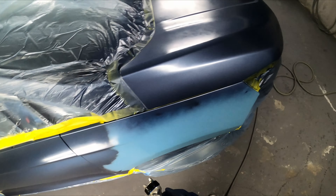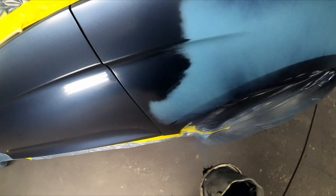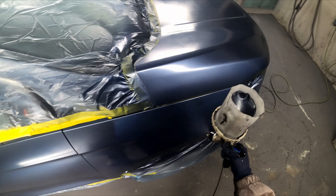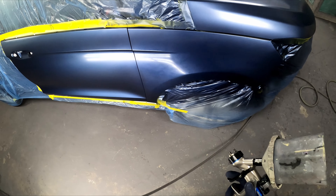This color has a lot of metallic in it, should cover easy. I used blue primer — covers that primer no problem. I do a second coat, sometimes a third, but two coats on this color covered it no problem. Make sure you're flicking that wrist to get that blend on the door started — you don't want to dead stop on the edge of the door.